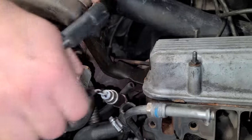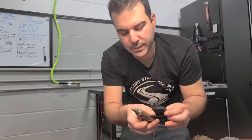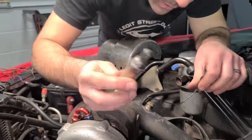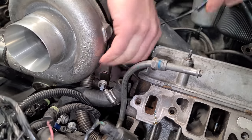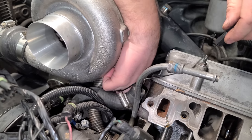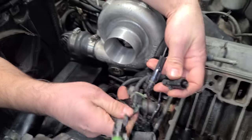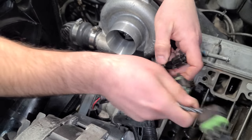We're getting rid of the three-wire O2 sensor — it's actually in pretty good shape, so we'll save it for our rescue car kit for old abandoned GM cars. We're going back in with the old school single-wire O2 sensor. The car will run open loop with the turbo tweak chip, so technically we don't even need any O2 sensor, but with the ScanMaster we can read the O2 sensor readings. We'll just add it in for a few bucks. Now this harness is completely cleaned up — just the basics up front. Looks so good.